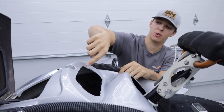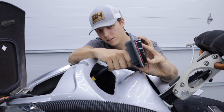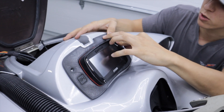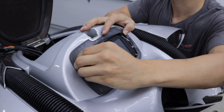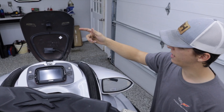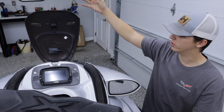I had already cut this out to make room for the new FuelTech ECU and already got it mounted here in the dash, so really just had to plug it in. I made this to where it screws into the factory holes for the dash. This is my first one so it's a little rough — I could make some improvements — but overall it fits pretty good. After getting this mounted, the last thing left was to put in the Can-Do Pro GPS module. I just stuck it up here — figured this would be the best place to get the best satellite signal, right on top of the ski.